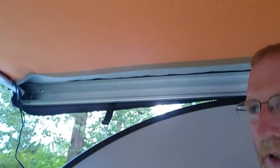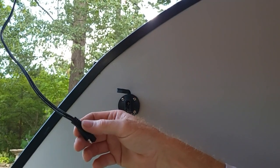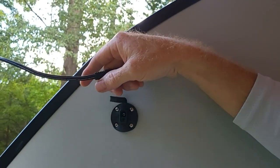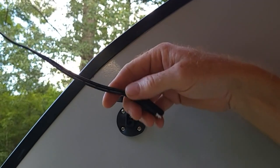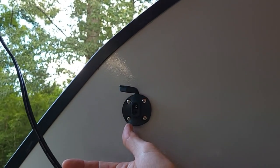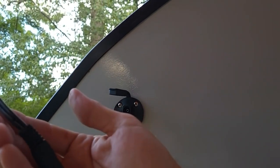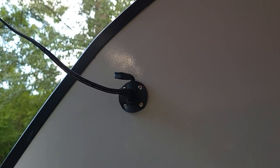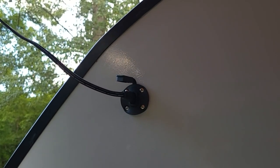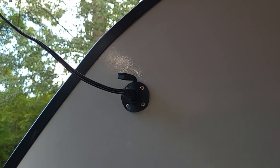Due to the LED light strip in the ARB awning, you have to power it somehow. It comes with a cigarette lighter plug from the factory, but on our Bushwacker the cigarette lighter plug was inside the galley — so if you wanted it plugged in, you'd have to keep the galley open. I added a simple SAE port to the side of the Bushwacker and changed the plug, so now the LED light just plugs into the side and the galley top can be closed if it's raining.